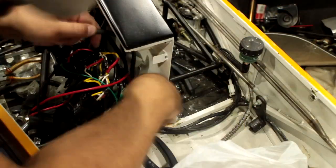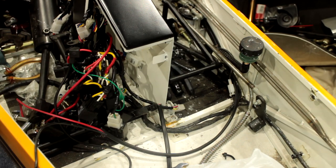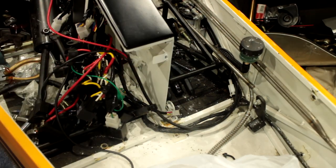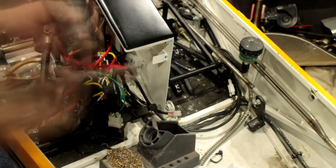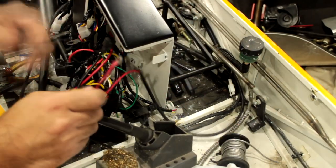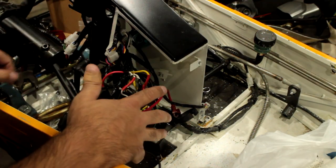When I do that, I'll run this other cable through as well. When the wiring comes around through here, it'll get tied in with these wires and come into the main loom. It'll have a terminal put on, and that'll get hooked up straight to the main starter solenoid. Then there's a wire that goes into the rest of the loom. It does have an inline fuse here, because that's where the battery was originally mounted. That's what's going on there.